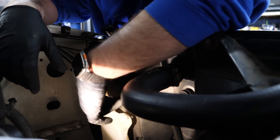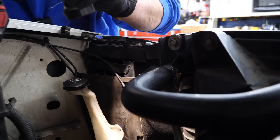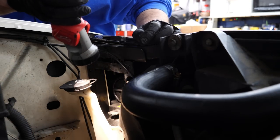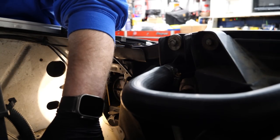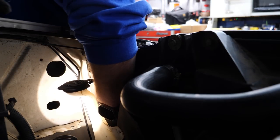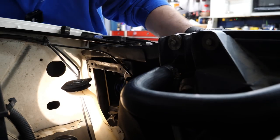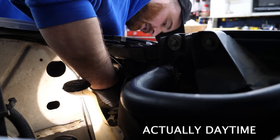The low beam is a little bit of a pain — it's all the way down at the base of the neck here. But I think that'll be fine. That's plenty of room to work. I'm not sure where the hell even the ballasts on this thing. I haven't read the instructions yet, but I believe the ballast gets unplugged and then the LEDs get plugged into like the power wire for the ballast. Let's see here. Okay, well, here is our high beam. That is simple enough.